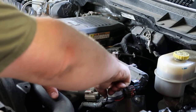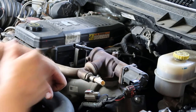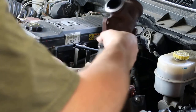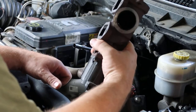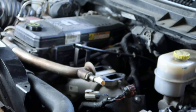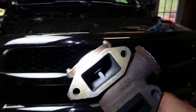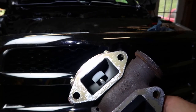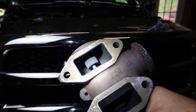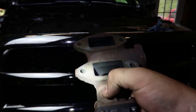You're gonna have a gasket underneath and you're gonna have a gasket right here on this crossover tube. It doesn't look too bad. I try to do mine about every 70 to 100 thousand miles, so it looks pretty good. Here's the EGR - if you look in there you can see it's not real bad, doesn't have a lot of carbon in it.